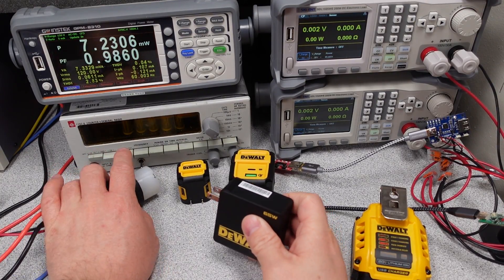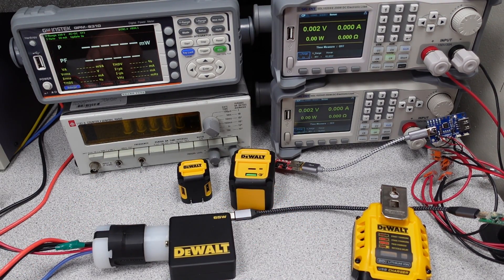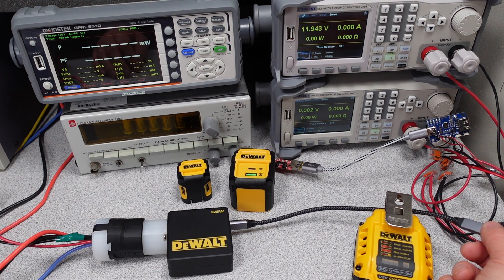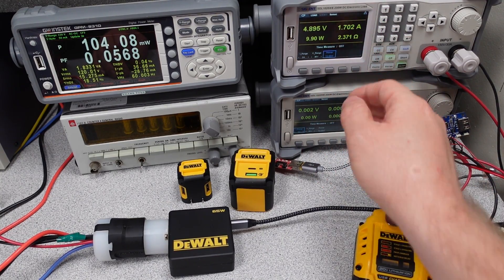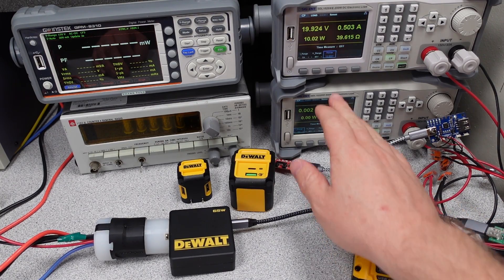During testing, these adapters had reasonable idle power consumption. The smaller adapters, for their extra size, did not bother with any significant AC line filtering, so the noise in idle mode is on the higher side. The 65 watt is a bit quieter in that condition. The 12.5 watt adapter is a 5 volt only device. The 49.5 watt and 65 watt devices add USB Power Delivery modes, supplying 5, 9, 12, 15, and 20 volt fixed voltages. The 49.5 watt adapter adds QC modes on the USB-A port, up to 12 volts. These power adapters all lack a PPS mode, so they will not provide the fastest possible charge to some devices like Samsung phones, though iPhones use the normal PD modes.